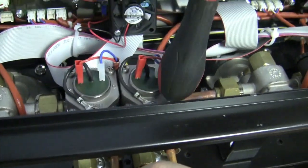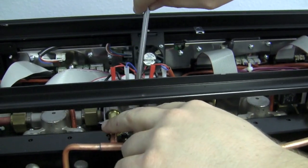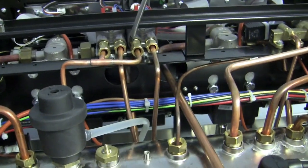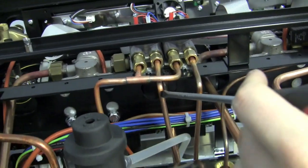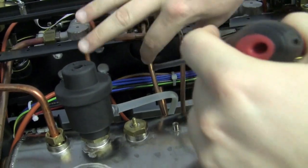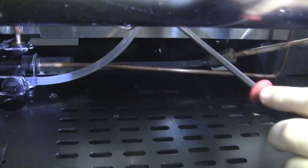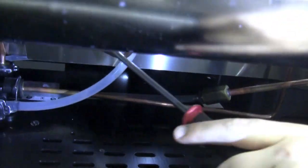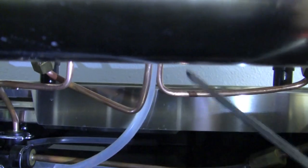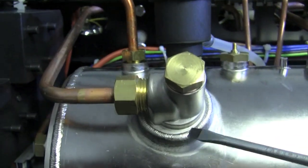That's why you have two of these — a three-group machine would have three, four-group would have four. The water comes in and goes back out again, cycling just to count as many times as it was programmed for. Then water goes back down into the heat exchange. We trace it down on both group heads — water goes all the way down into the bottom of the heat exchange, and then it comes through that little tube. It started cold at the bottom and now it's going to be piping hot up here.